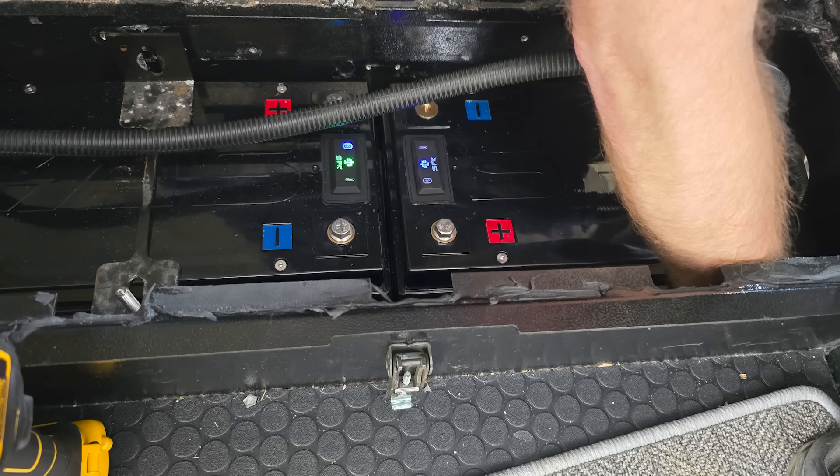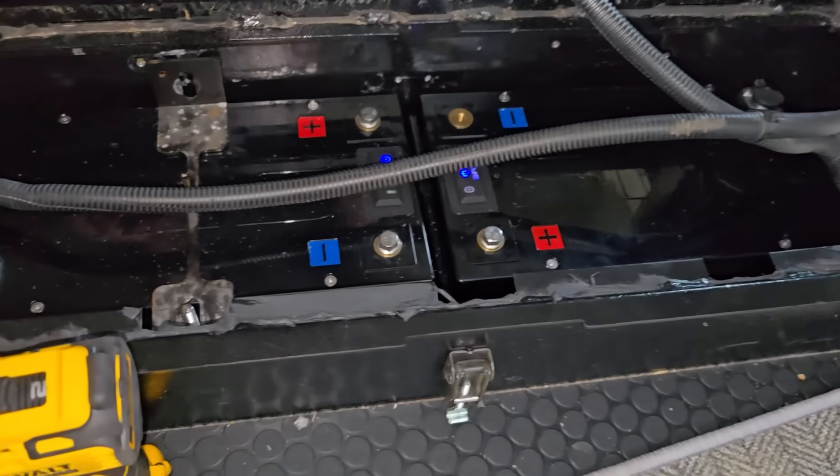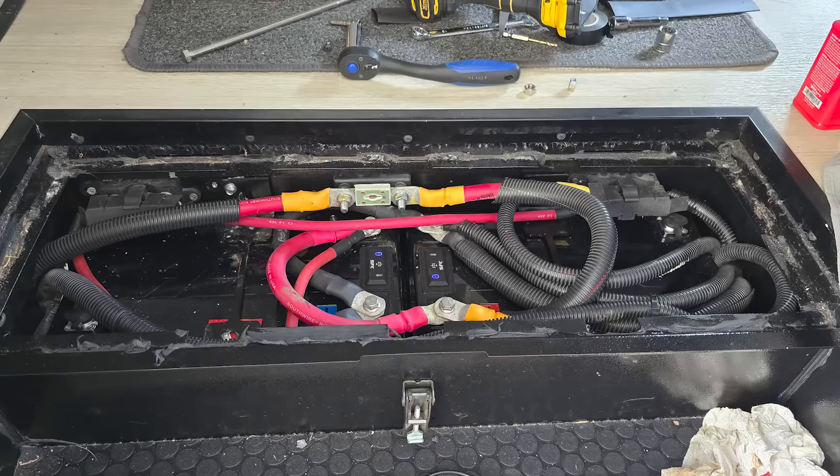Once you have that, you can position your batteries. The way the batteries sit, you're going to take the mounting bracket and flip it — invert it — and that's going to give you the clearance to actually secure the batteries in place. Batteries are in and we're putting new mounts to hold them in place. We've flipped the brackets so instead of pointing down, the battery retaining brackets are up. We were able to use the stock brackets, which is great.